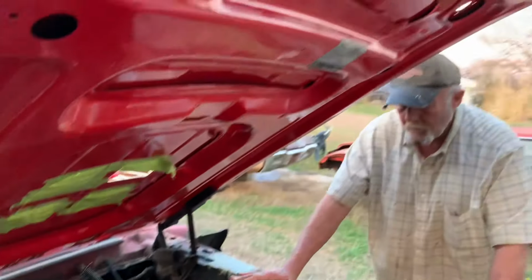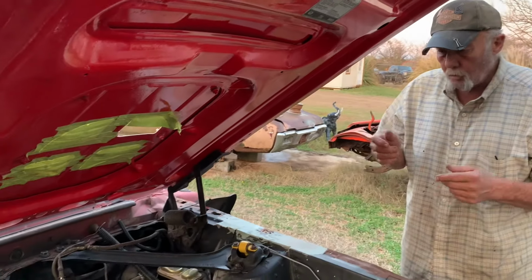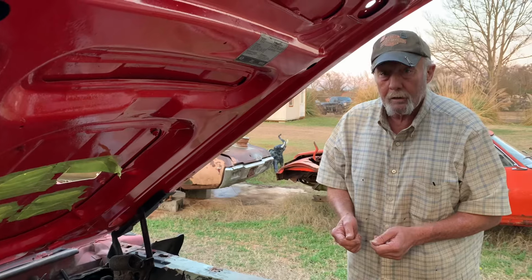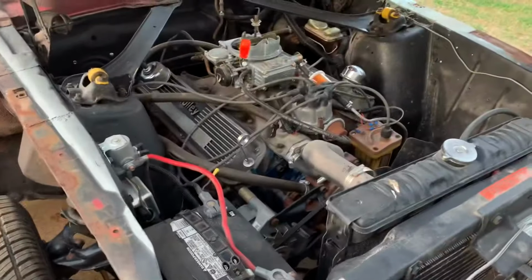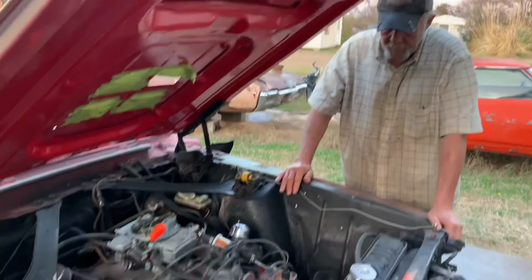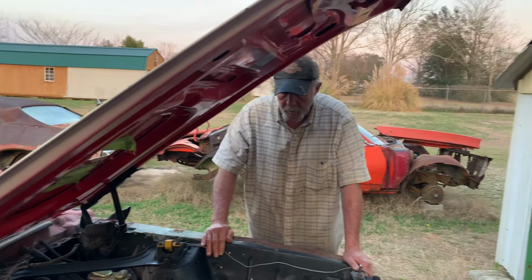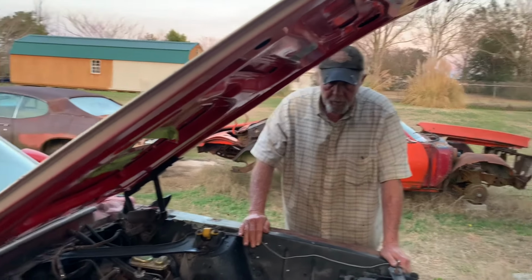What I was going to tell you, what I'm noticing is that we got a skip. Mm-hmm. Okay. Now, if there's a chance we got two wires crossed somewhere, that could be causing that knock. It could be that cylinder's firing when that piston's trying to come up. So, I believe the skip is on that side. I believe it needs an oil change, too. A what? Oil change. I think that'd help, because it's getting worse as it's running, which is the oil's getting thinner as it's heating up.